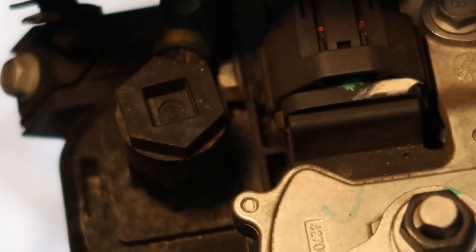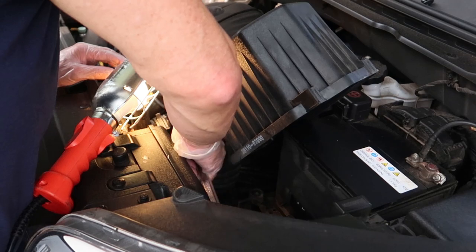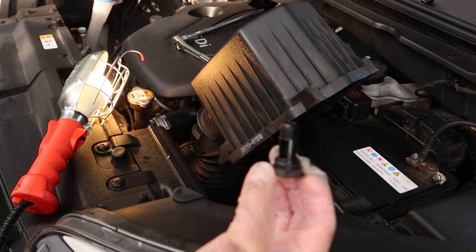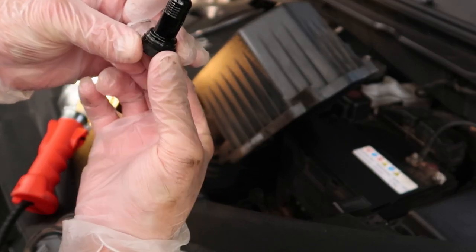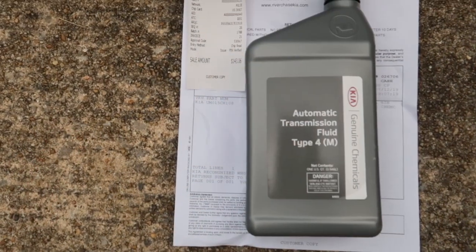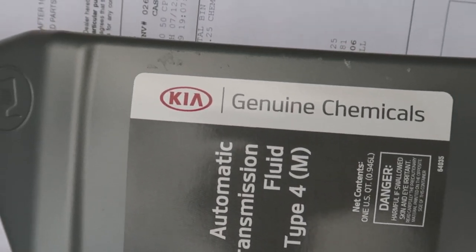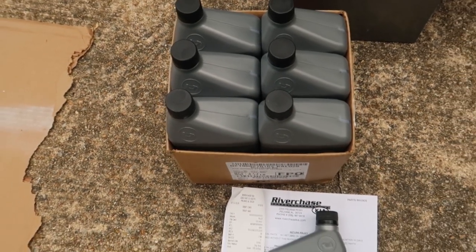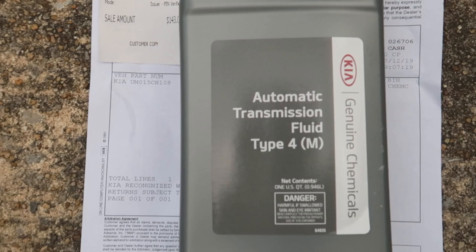Kia kind of went a cheap route here — they went with a plastic hexagon-shaped fill plug. You just take a 3/8-inch socket wrench and pop it straight in there to break it loose. Since it's made of plastic, there's not a lot of force needed. I found it was easier to access this bolt by putting an extension on my ratchet. Once you get this bolt out, inspect it for any cracks, and there's a small plastic O-ring at the base — take a good look at that. I've only got 60,000 miles on it and the O-ring looks good, but if you see any cracks or if it's torn, you may need to replace it. For automatic transmissions, I always like to use the genuine transmission fluid because of compatibility issues — a lot of aftermarket fluids have different cleaners and agents that don't mix well with the original. It's $143 for a case at Kia, but I think it's well worth it for the longevity of your transmission.